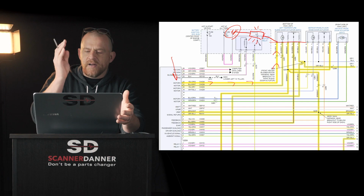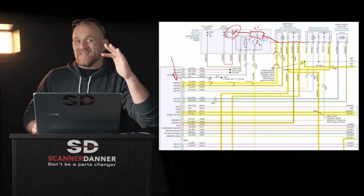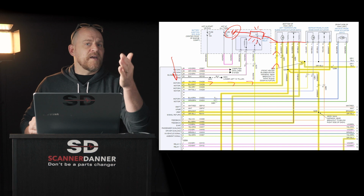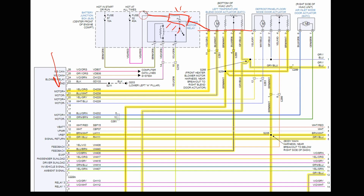But that's only one. You're not done on that wire. That tells you your wire is good. That tells you the driver in the computer is good as far as the positive side, but you want to make sure that the negative side works. So once that light lights and you're happy with that test, the next step would be to switch your test light to positive and look for a ground, and that same wire that was power should now be a ground. So we move the motor again, either positive or negative, hot or cold in this case, and I want to see this light flicker, which is going to tell me that that computer driver was able to ground the circuit. Does that make sense, Caleb?